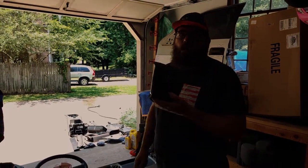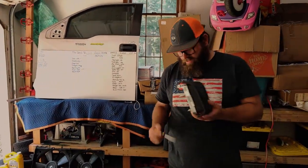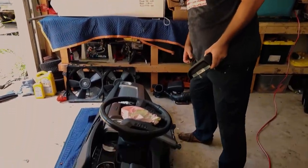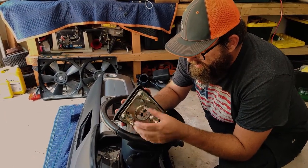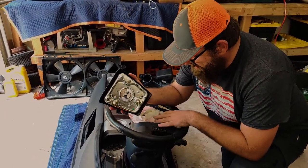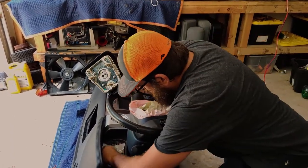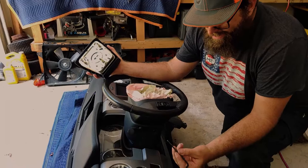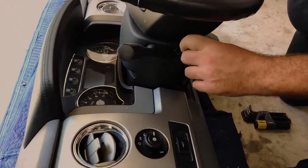So while we got this here, we're gonna go ahead and pull the old airbag out, put the new one in. So should be pretty simple. You got these three barbs right here. Yeah. And they press in and they lock in place. And so on the bottom of this steering wheel, there's holes and just like an Allen key basically. And you see this hole right here and you just push this in there